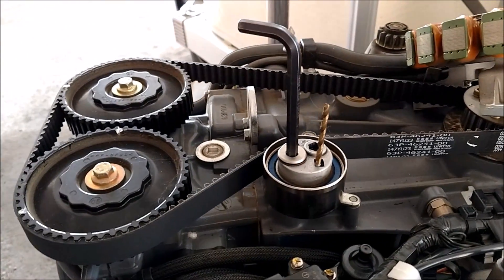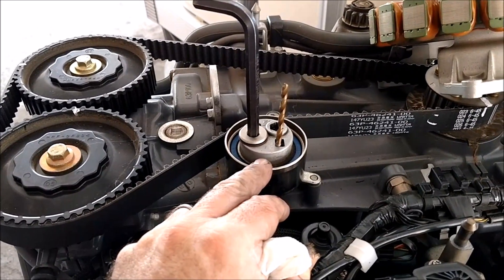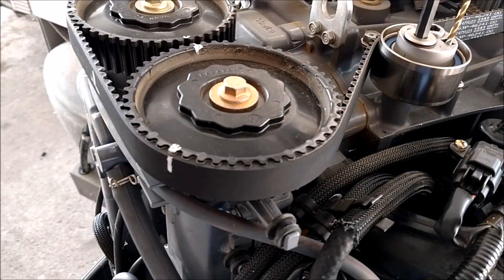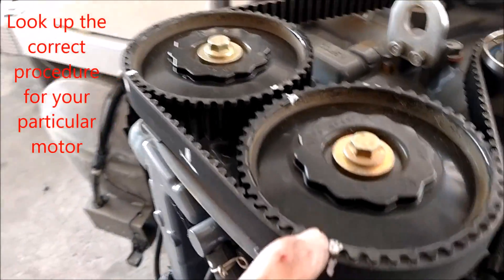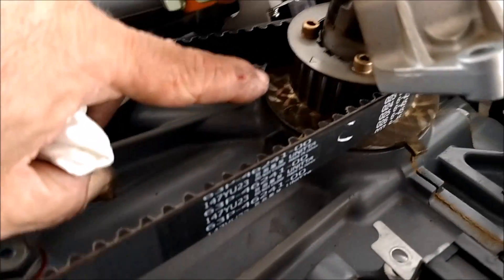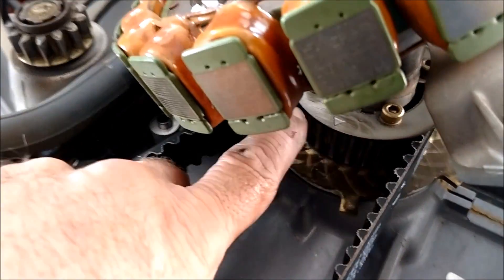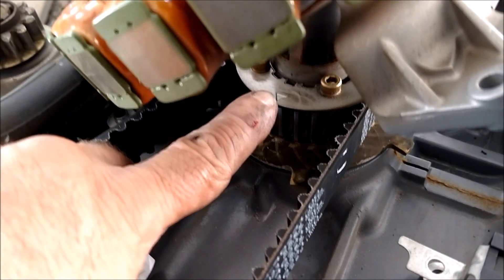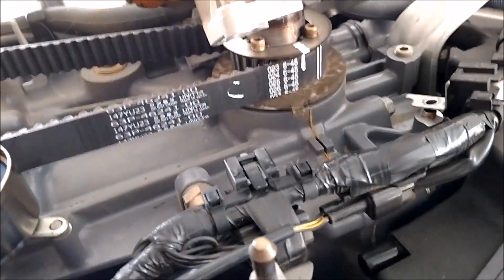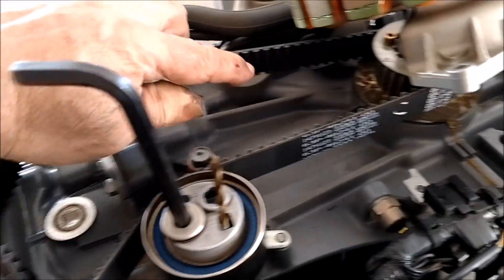We're back on the tensioner and how to release it. We've gotten the new belt on. We marked the old belt and then copied our marks over. I always do a little T for top and then mark each cam with its own unique spot. Plus, we're going to be lined up here in the center also. On the 2005, 2006, maybe 2007 F-150s, you've got a little triangle on the crankshaft and it lines up with your line here. Since this was running and this is just done for maintenance, we pre-marked everything, so we're putting it back exactly where it went when it came off. We've also gone through and verified our marks and will verify them again when we're done.